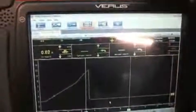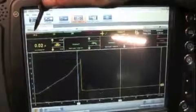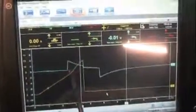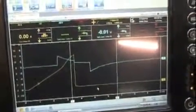Go back to my Labscope and there's no blue trace. Remember, we have to turn that on. So I'm going to select traces. Trace number 3. Again, remember we got yellow, green. Trace number 3 is blue. It's undisplayed. I'm going to click check displayed and OK. And now you can see that we've got the blue trace, which is showing our cam signal.